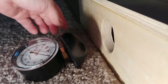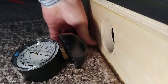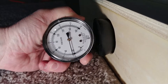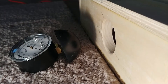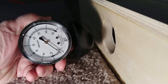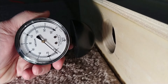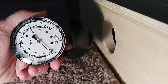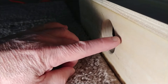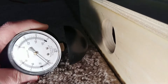This is going to be super loud, so please turn your volume down. I'll review the footage, but I think I saw about 35 inches of lift, and if you remember the Kirby Avalir, I think that was about 30 inches of lift. So definitely more suction. Of course, this machine right here does not have a removable head, and the Kirby does, so there's an extra seal in there that the Royal doesn't have.